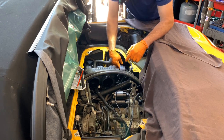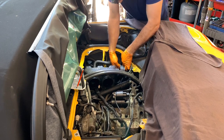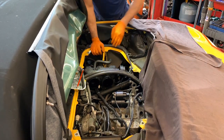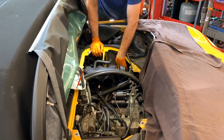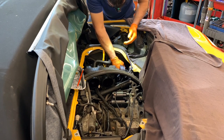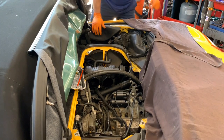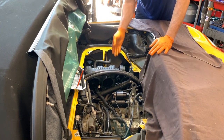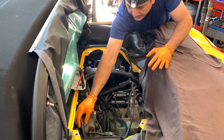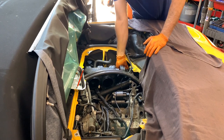All right, before I almost forgot, before we set the injectors, we need to put that crankcase ventilation hose. Ooh, that would be a hard thing to do with the injectors in place. And it's a breeze if you do it now. You'll see it's the same hose here. Hopefully, you guys can see it's just a flexible squeeze connection that has an O-ring on it.